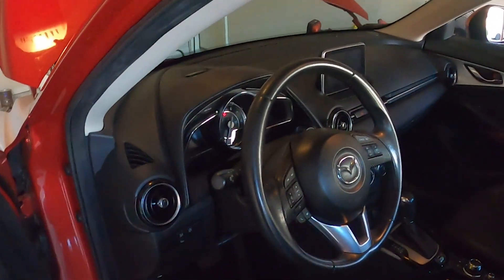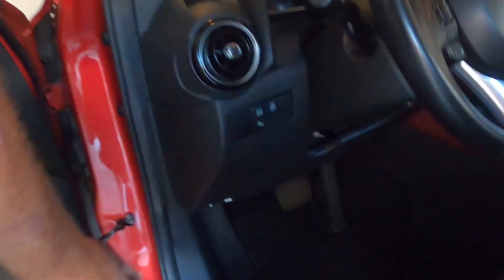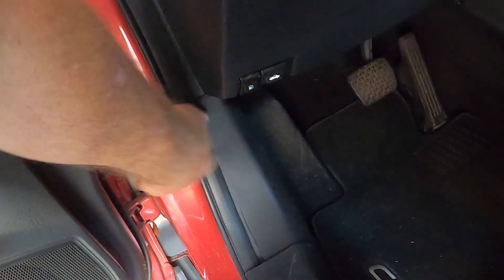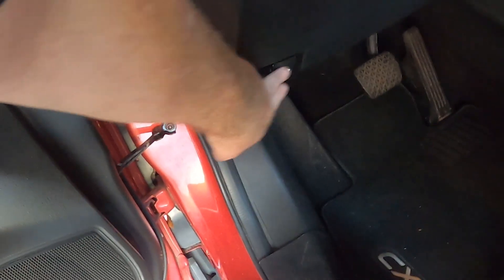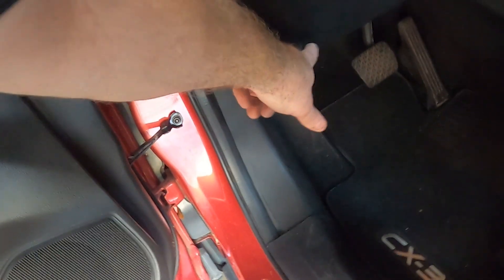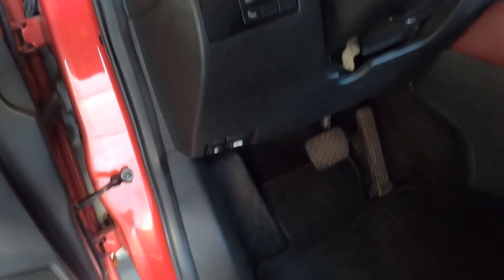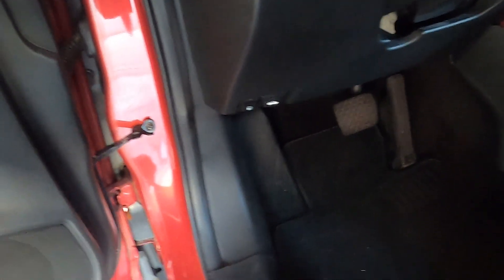All the dash panel stuff is back together — everything looks good, everything's in its place. There's a 10mm right back behind this panel; this panel comes off with these little clips right here. There's a screw on the other side, cable comes out, and there's a knee support bracket right here with two 10mm bolts. It's really simple and pretty self-explanatory.